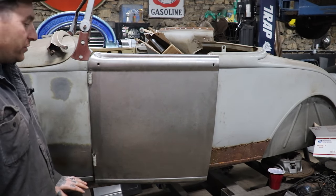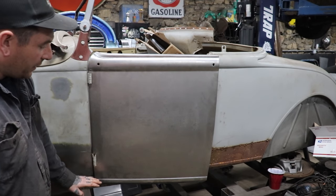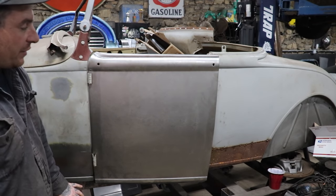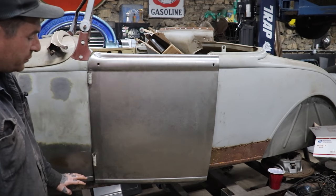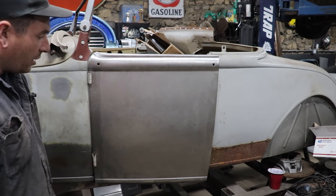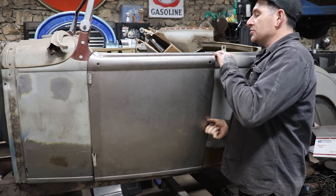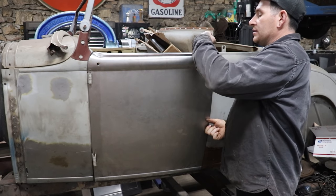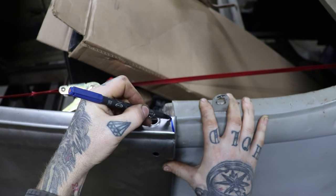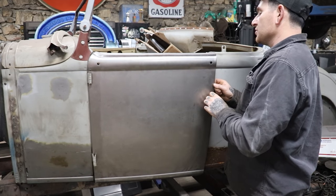As far as I'm concerned on these early cars, one of the big things that gets overlooked when doing patch panels is that the body lines don't match up right. So if you're doing patch panels you want to make sure the beads line up pretty good and also the shape of the bead. If you put a patch panel in from a couple different brands, a lot of times they tend to vary and they vary from the factory. That's why when Aaron was talking about doing all this, one of the doors he didn't want to do and I kind of said you really should because the patch panels on either side of it, the bead is going to be completely different.